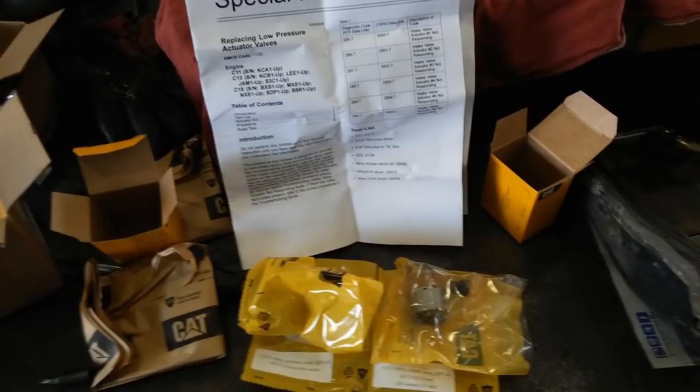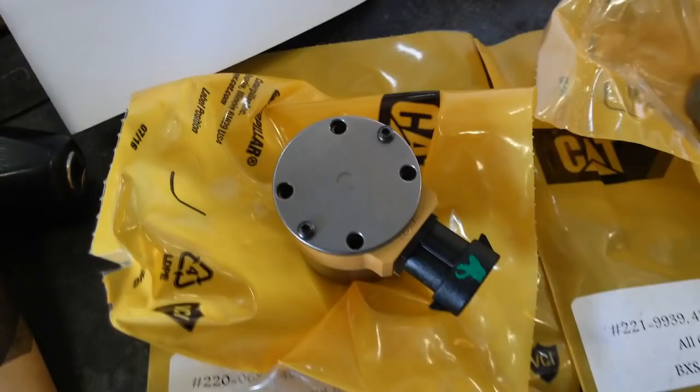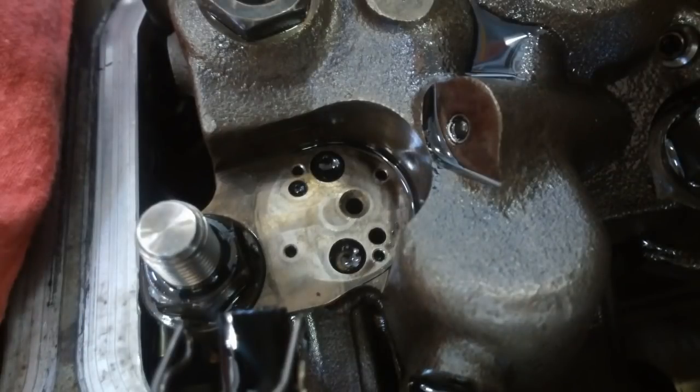When you open your box, you will have two smaller boxes, each containing a solenoid. You will have bolts for each solenoid in two different lengths — read the description on the bolt bag or compare to the old bolts. You'll also get a detailed instruction sheet. The new solenoid has two smaller retaining screws holding it together because the solenoid is segmented. You'll want to clean the mounting area and inspect it for cracks, which are somewhat common between the oil portholes.